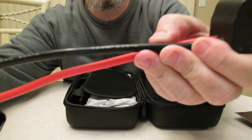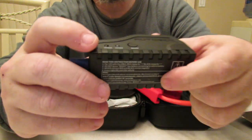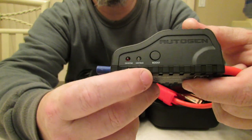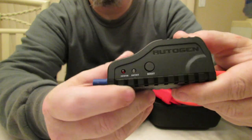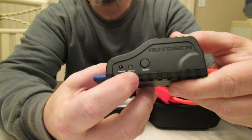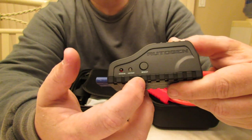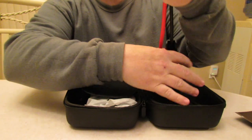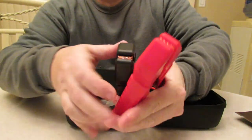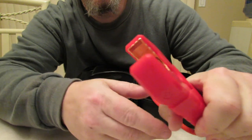Here are the nice smart cables — seven gauge wire. The smart module has a reverse light, a correct light, and a boost button. If you hook them up wrong it will light up red. If it lights up solid green it's ready to jump start. If it's blinking, it's not detecting your battery because the voltage is too low, and you'd have to hit the boost button to override the security features.